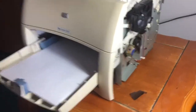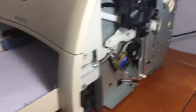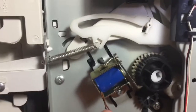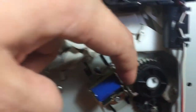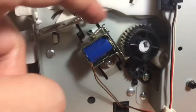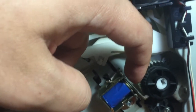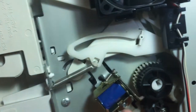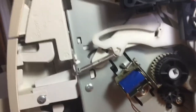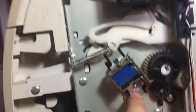So I figured I'd make a video and show you what did fix it. Basically, you'll want to open up the right side of your printer and you'll see this is actually a solenoid. It has a little L-bracket - the metal is an L-shape and it helps the feeder. What was happening is the L was actually sticking to the metal on the solenoid, and when it was sticking it was pulling the paper feeder a little too much.